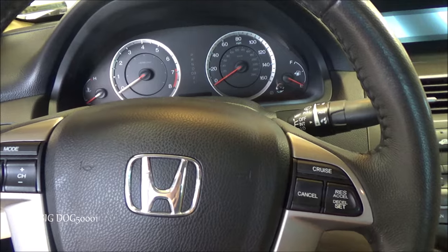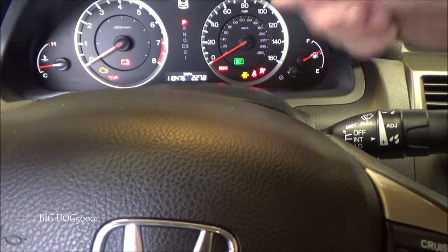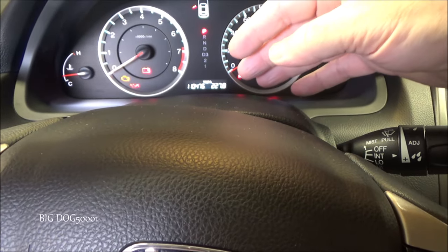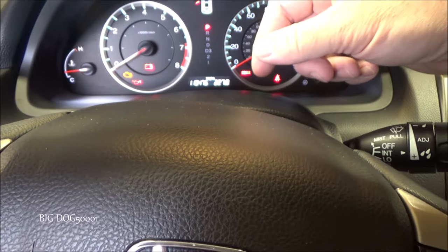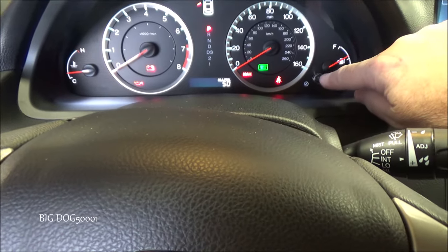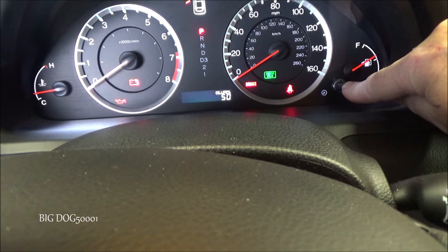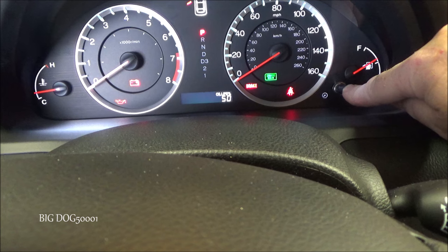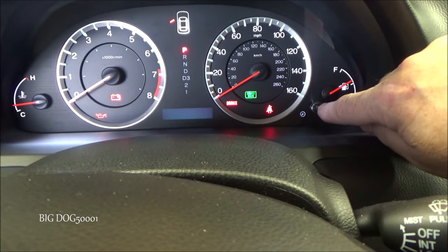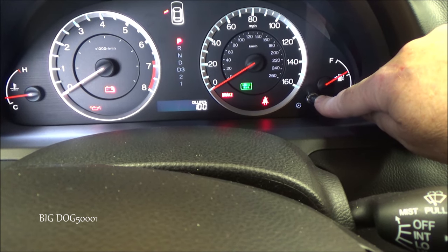The oil on this vehicle is changed every 5,000 miles, so we don't wait for the maintenance minder to come on, but we'll go ahead and reset it. On this vehicle from the driver's seat we can only reset everything — the entire maintenance minder system resets to 100% including the oil. If I wanted to reset just the oil, I'd need a Honda scan tool. To reset it, turn the key on with the engine off, hold it for about 10 seconds until it starts flashing — it'll show items like B123. We're just going to reset the whole thing. Hold it again for at least 5 seconds until it clears and goes to 100%. There we go — good to go. If you're following Honda's maintenance minder system, make sure all those services are completed before you reset them.